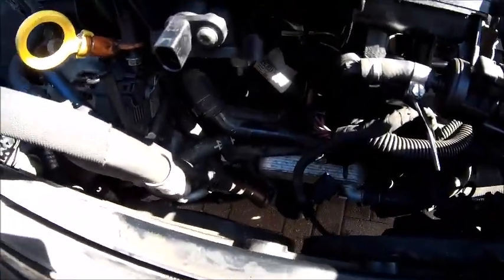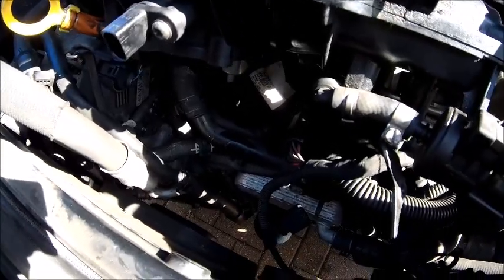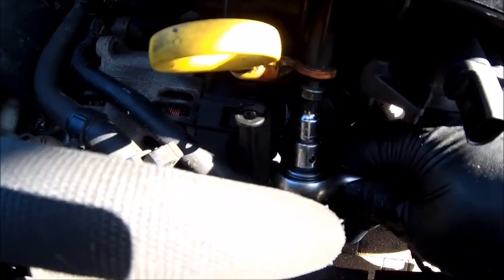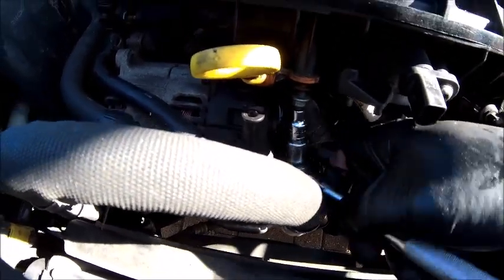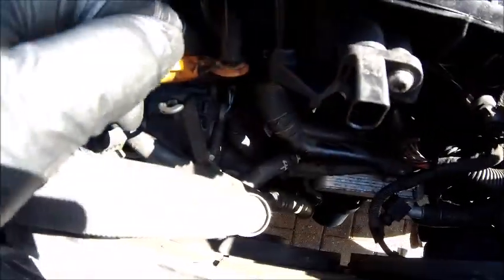Okay, so the 13mm bolt's off, but there is a spline bolt right in there. Oh, God. This is fun. So the saga continues. To get into that bolt, the dipstick tube is in the way, so you've got to take this bracket support off here. That is a 4mm stud. So that's got to come out, and then we might be able to get the dipstick tube out and actually get somewhere near it. Right, so that stud's out. That means now the dipstick should just... maybe I can just move it to one side.